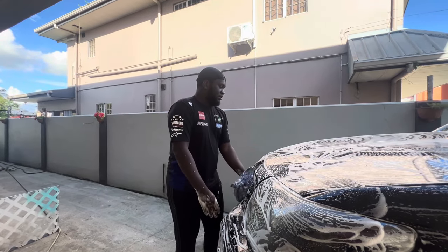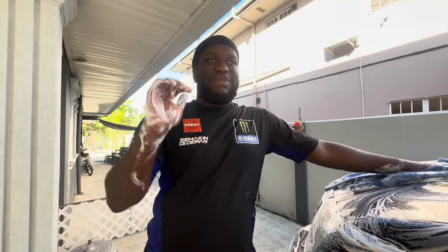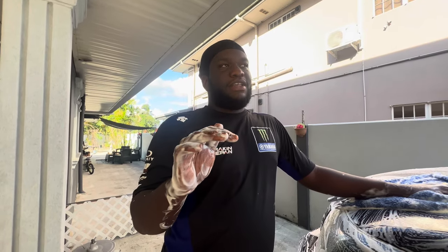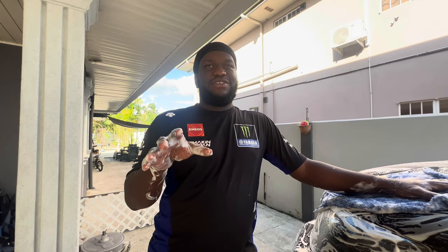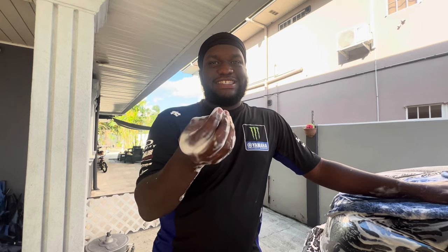Explain to them how the axle gets in this position. Okay, so let me explain why I think my axle is broken. I was slacking off a little bit, and I was driving with my burst boot rubber. It had no grease in it, and I was driving like that for a while. And I decided to go off-roading in Wallerfield, and that kind of mud is like gravel. So I think gravel got inside the boot rubber, and now the axle is making noise when I'm in four-wheel drive. So the best thing to do is probably change the axle.